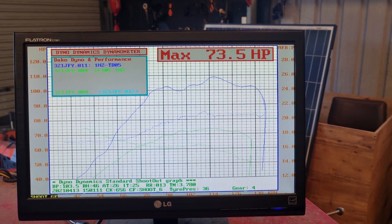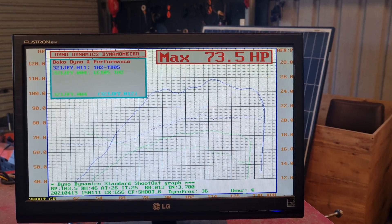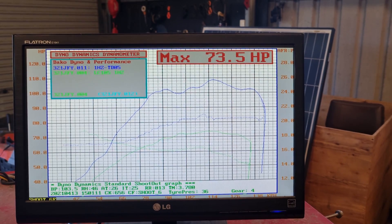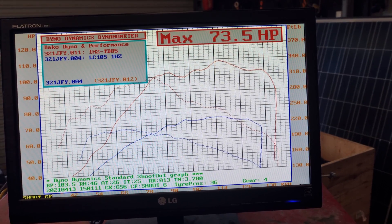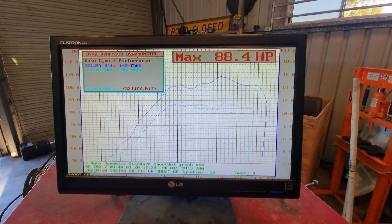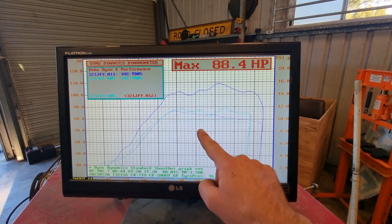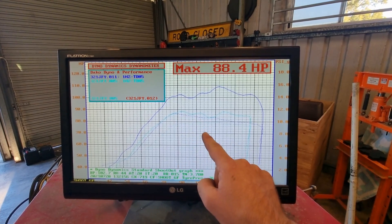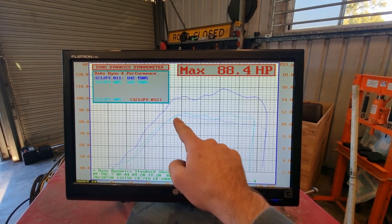Compared to NA, the power difference is about 73 horsepower to 110, and AFRs are changing from about 16 to 20. Peak torque has gone from about 210 to 310 foot-pounds. This graph also shows the impact diesel has on boost — gained a couple of psi in the mid-range just from adding diesel. Light blue was the first power run of the day without diesel; dark blue was one of the last ones we just done.